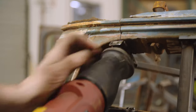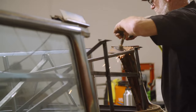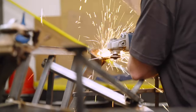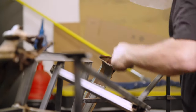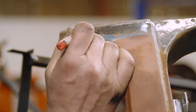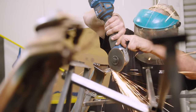We've still got the rear section of the roof to drill out. We'll take this off and then we're going to unpick the top of this pillar the same as we did with the B-pillar. There's a nice joint under here with spot welds going upwards so we can use the inner structure of this pillar and the factory weld positions to hold it in place, but we're going to have to take the outer skin off to replace the strengthening inside the pillar. We can't just cut through the pillar and butt weld it - there's no strength in that.